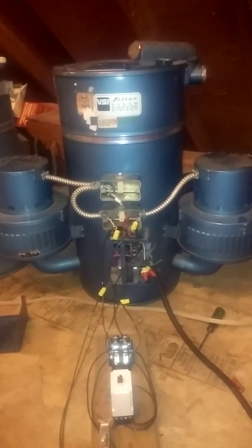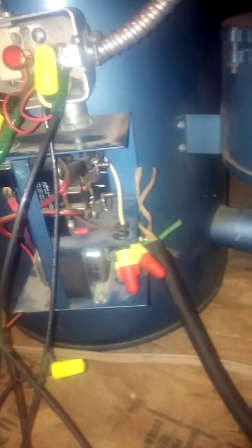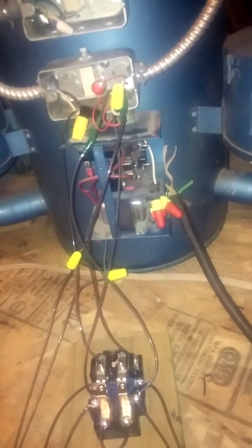That's the cool machine to play with. And what we've got in here is the relay and the transformer that turned the vacuum off and on from the wall inlets with 24 volts. The wiring I had to modify, of course, to take each motor and hook it into this relay, which was added. And this is a double pole, double throw relay that goes from a normally closed contact to a normally open contact when the relay fires.